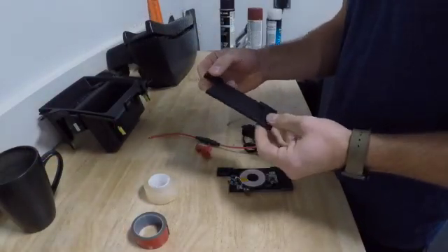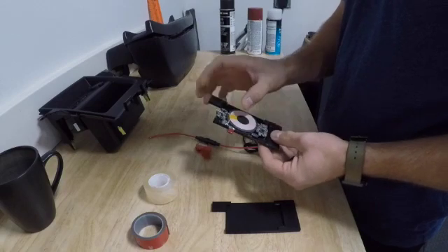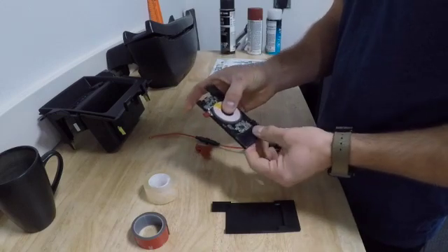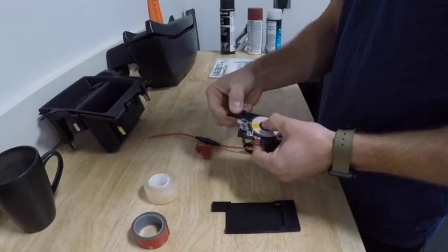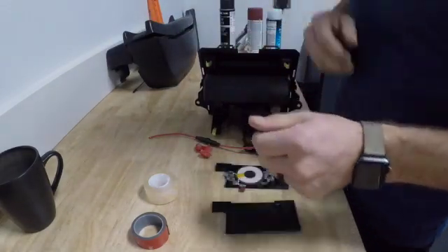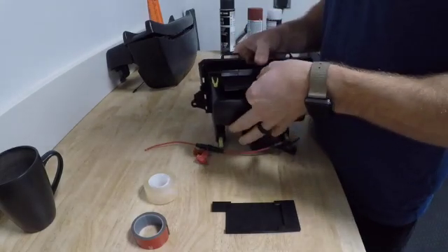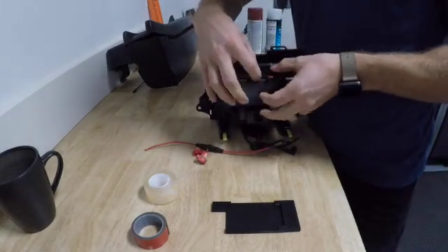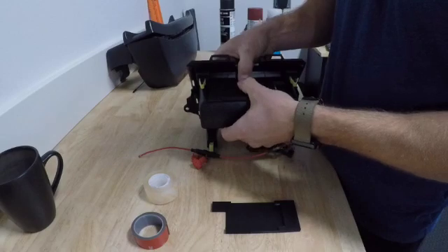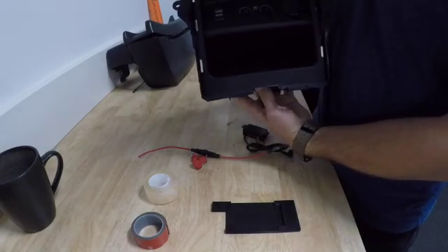What I've got here is something I've designed in CAD and ultimately 3D printed, and it perfectly fits my wireless charger into it, nice and tight so it won't come out. I've applied double-sided Gorilla tape here and here, and that's ultimately going to hold it to the bottom side of my dash component. I set this in here between these two posts — I've designed it so it fits nice and tight — and it butts up against this little support bracket, giving you a dead center area for a charger for your phone.